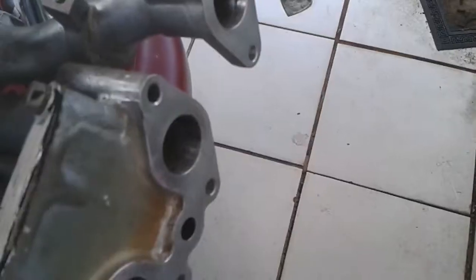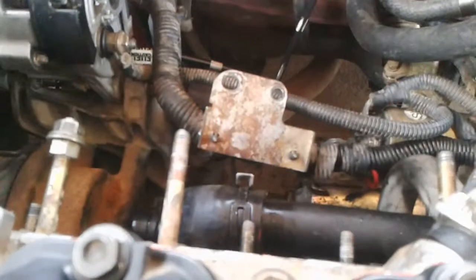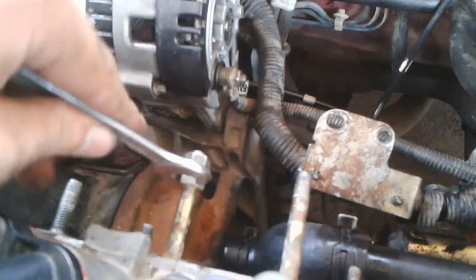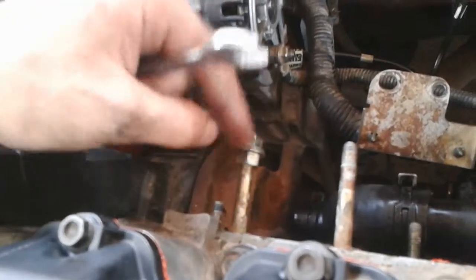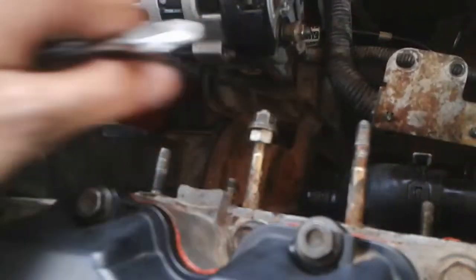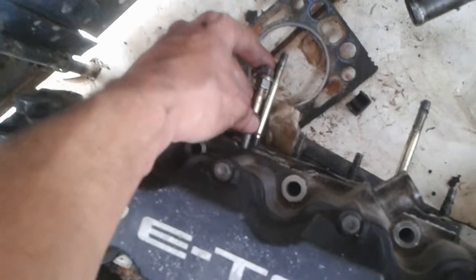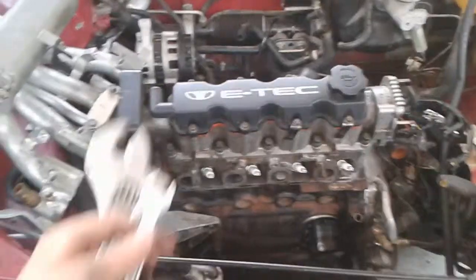I was about to finish when I went to install the air intake manifold and noticed that the studs are shorter than they should be. I screwed two bolts together to improvise a stud. I'll check if the thread is long enough; otherwise I'll use studs from the other head of the old engine. They turned out to have nothing in common — about half the length — so I have to do this whole procedure again, round two.